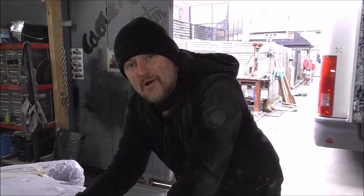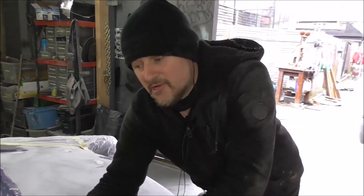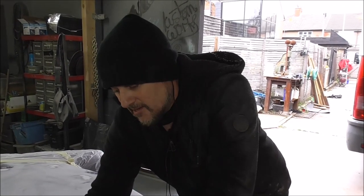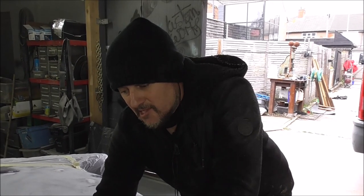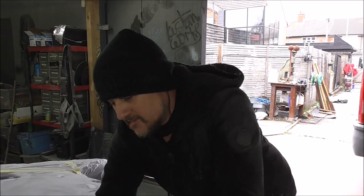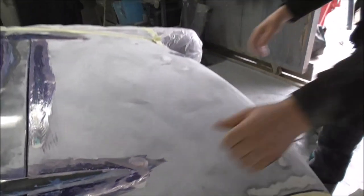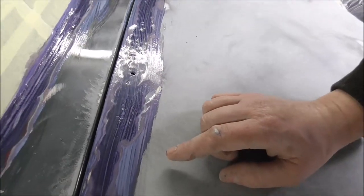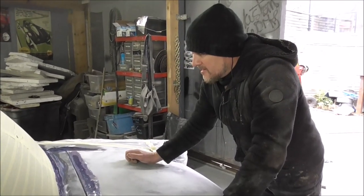You might be thinking: why am I not welding a plate on over it? The thing is, the minute you weld on steel, just the heat of the welder will change the make-up of the steel and make it rust even quicker. This is a car with some rust and I'd rather not weld on there because the weld itself will start to rust and then that will lift the filler. So with fibreglass over that it should be a lot better. And with the same rust treatment, putting a very thin layer of fibreglass over that should help.